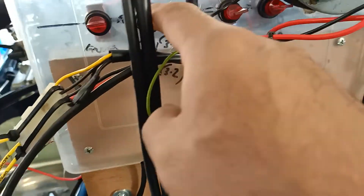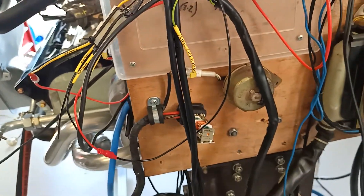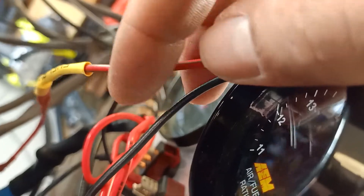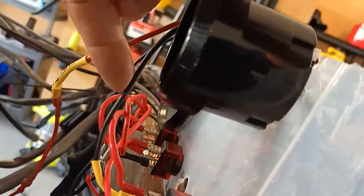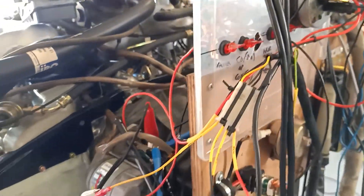There's a harness that comes out of the Motronic harness and goes to the coil — you get power and ground, and that gets connected to switched 12 volts as well. Out of the DME sub-harness there are two wires: a red-and-green wire that goes directly to the fuel pump relay, and a black wire that goes straight to the coil — that one also needs 12 volts.